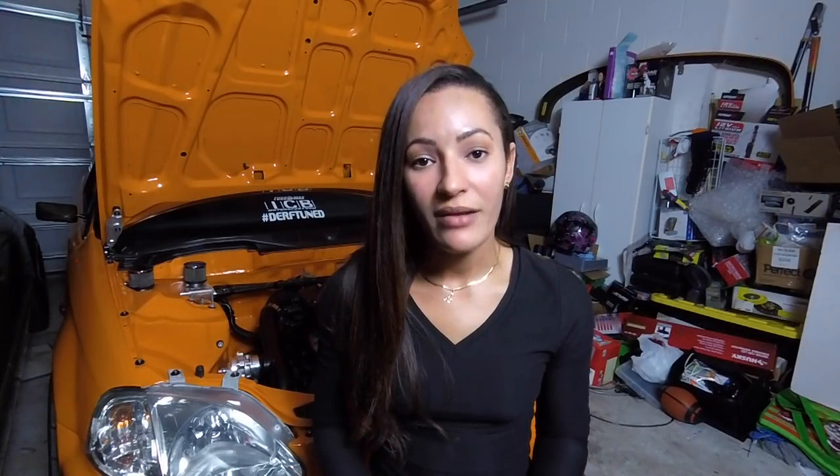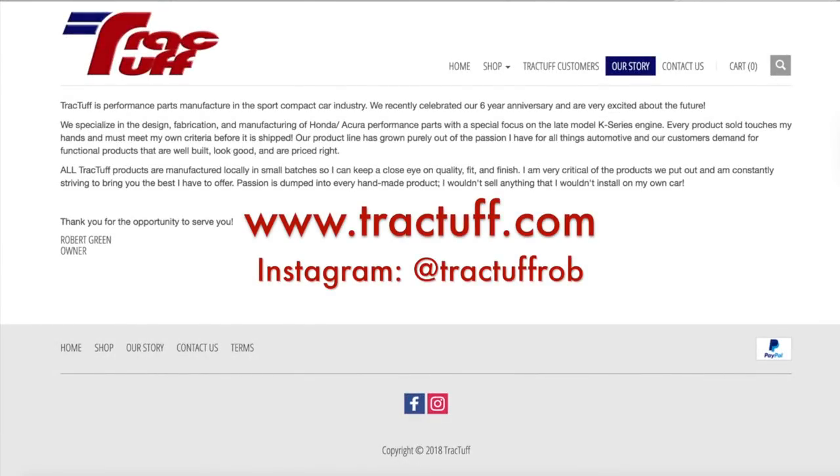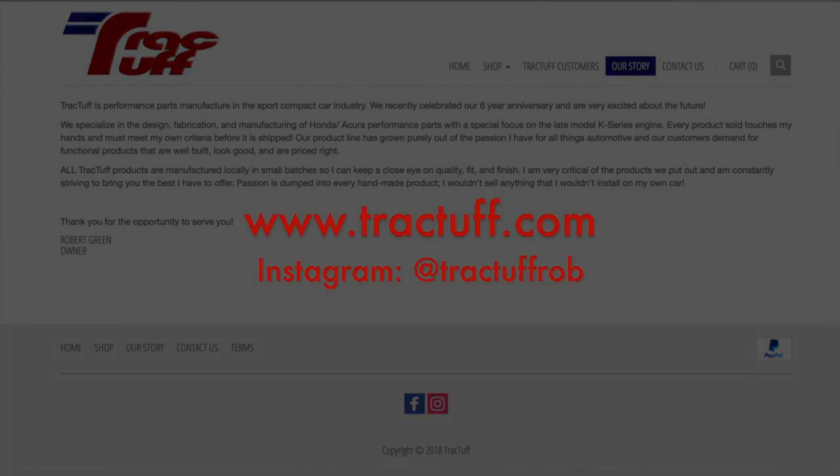By that time I had done some research and came across what's called a swirl pot. The function of a swirl pot is to help remove air from the cooling system — there's a swirl effect created inside the pot that helps remove air from the coolant or water before it returns back into the rest of the cooling system. If you have problems with bleeding your system or air pockets trapped in your system, the swirl pot will help. Especially for tuck radiators, they are sometimes a little difficult to bleed because of their position — they're lower than the engine, so you can have difficulties getting the air out of the system.